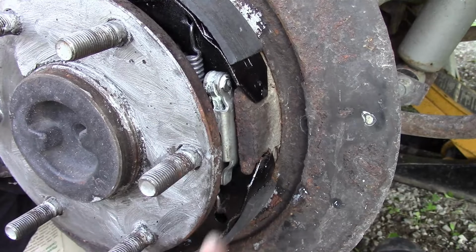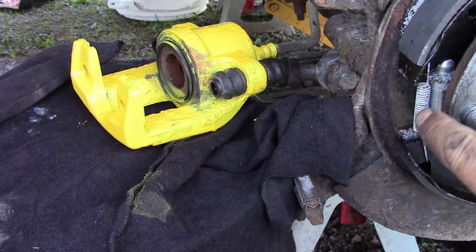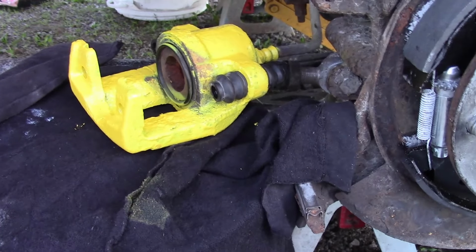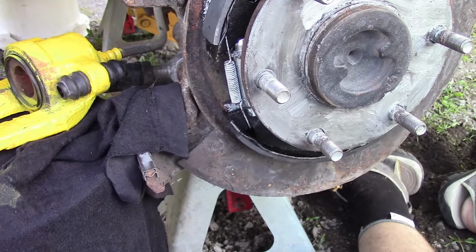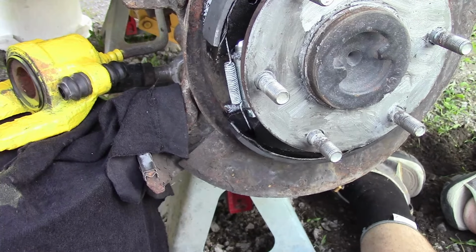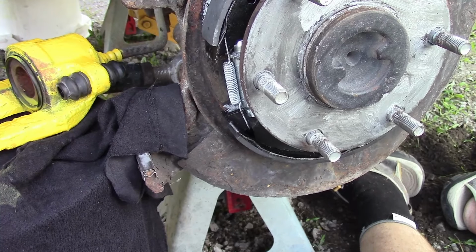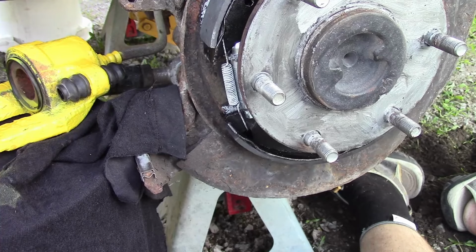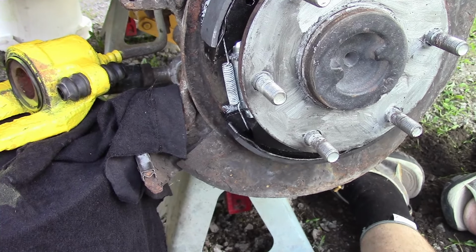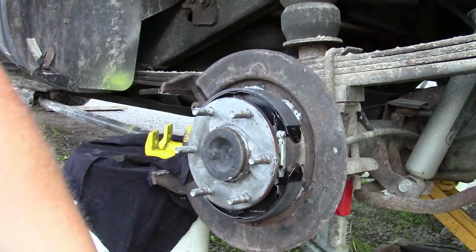So after the nightmare of installing this spring is over, move over and set our adjuster in here and then install that spring. That spring is pretty easy. And then we can test fit our rotors, make sure it goes on over top, the hub spins freely, and then we can press the brake pedal and see if the pads engage the inside of the rotor, and release it again. So we'll just test that, and we can adjust our adjuster out if necessary.